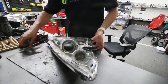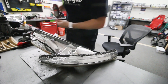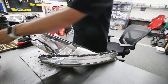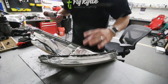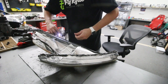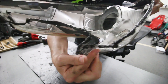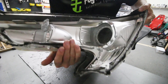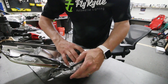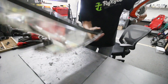Make sure the surface is nice and clean — no debris that'll mess up the lens. I'm taking out the internal screws and setting them all together so we don't lose anything needed for reassembly. Some screws only hold the internal pieces to the main bezel; others actually screw it to the lens — just take out the ones screwing it to the lens. Also, look for any glue sticking up and lay it flat so it doesn't touch the lens when we take it out.